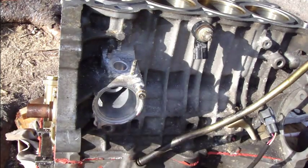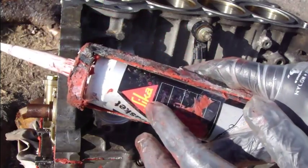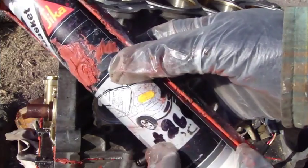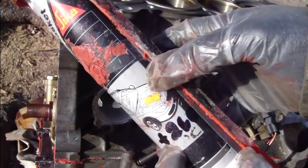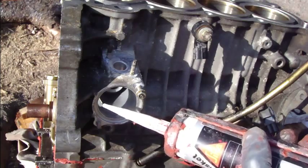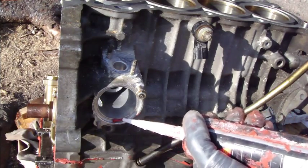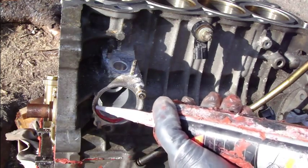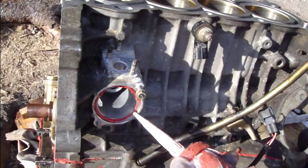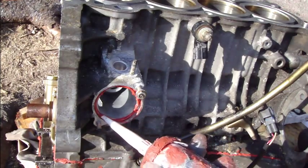Because sometimes there can be leaks. I plan to install this gasket glue. I have my favorite — this Sika brand. There is Sika seal gasket. And this is excellent for car repairs, where there is this yellow area. The Celsius temperature resistance is plus 260 Celsius — it's really hot, a really hot boiling area. And in here normally this temperature is something like 100 to 110. And then I insert this glue in there a little bit — that hole, and in this up area. This purpose is only that I don't like any leaks. And this gasket is also easy to take out; this is elastic.